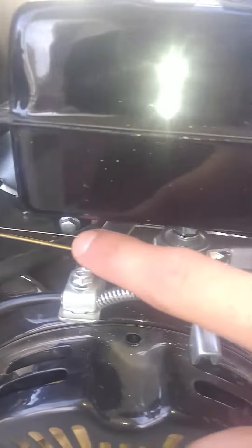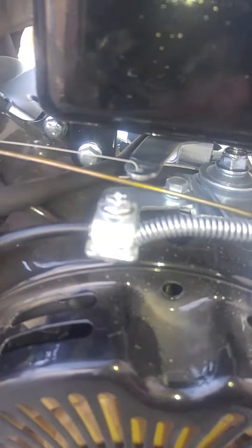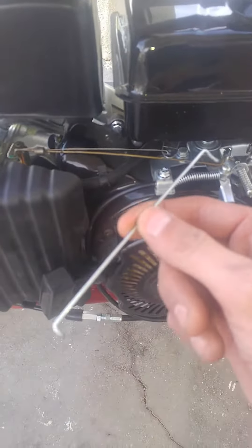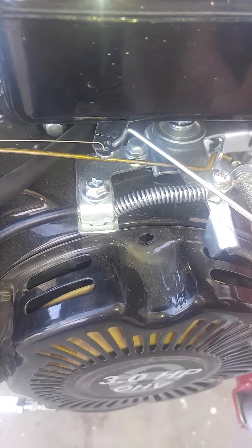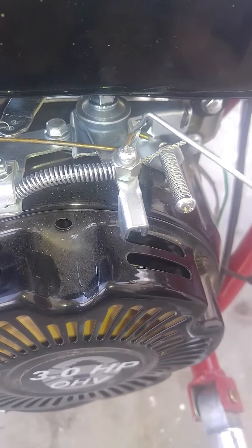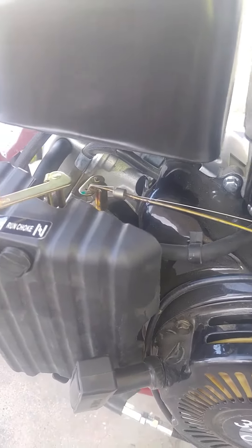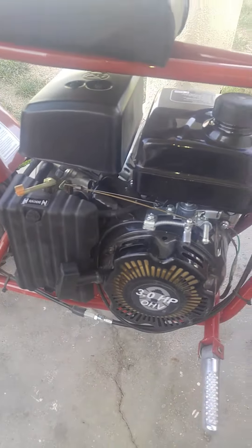What you can see is what I did here: I took off the original throttle linkage and then I got a coat hanger — you can see the coat hanger wire here. That's the original throttle linkage that was originally connected to that hole right there. I bypassed the governor throttle linkage and hooked it directly to the throttle itself. Now when I get on the road, there is no slowing down — this thing just goes and goes.